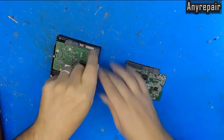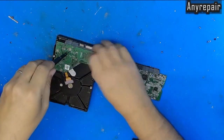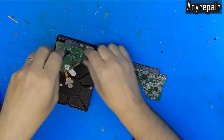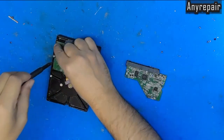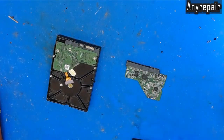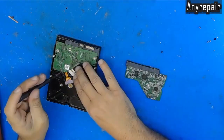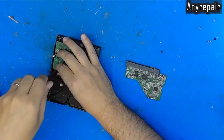Let's remove the board. The reason for swapping the BIOS is because the BIOS IC is paired with the HDD itself, and the easiest thing we can do is just swap the BIOS ICs. Of course, we could back up the BIOS and restore it to the other one, but that's a lot of work.